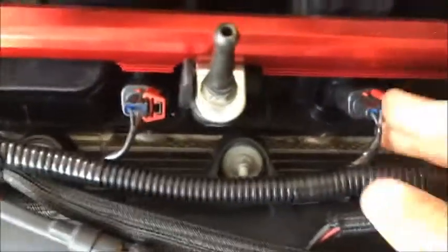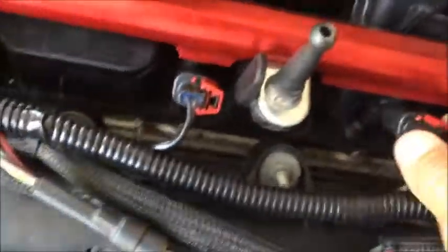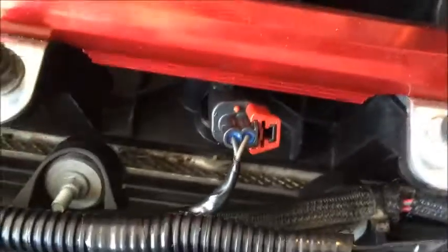The sensors that need to go up front go underneath the intake. The wiring that comes to the back and sides is for the injectors. I had to put pigtails on for these style injectors — I think the pigtails came off of my MDS wiring harness for those solenoids. You get four of them and they happen to fit the injectors too. The EasyFi multi-port kit came with a Bosch-style injector connector, so I had to cut those off and put these on. These are EV2/EV16 connectors — you can get a whole set of eight for around $14 with free shipping on eBay.